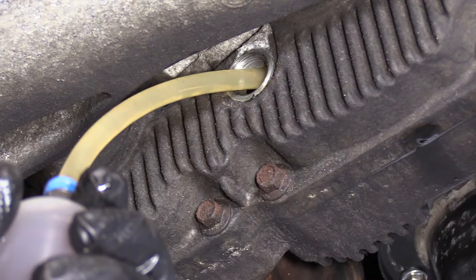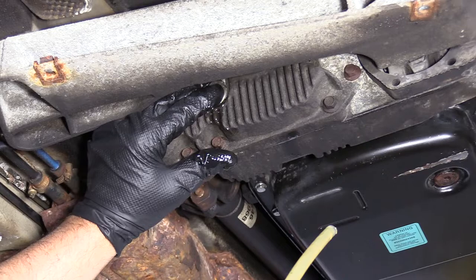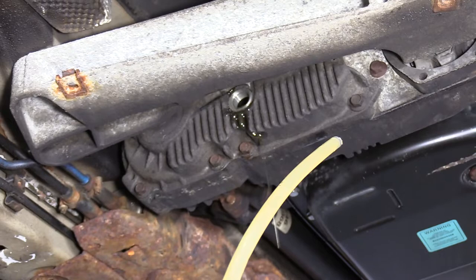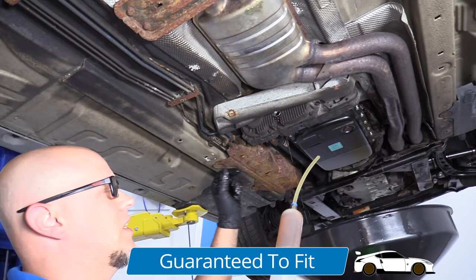It's starting to pour out. I'm just going to put my finger over the hole, let it disperse. Wait a minute or so, and then let it drain out. You want the fluid right at the base of the hole — it's got a nice stream, so it's good. It's important to make sure your vehicle is level when you're doing this because if the vehicle wasn't level, you're going to either add too much or not enough.